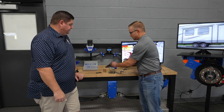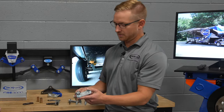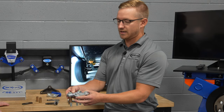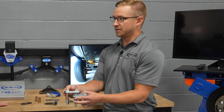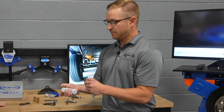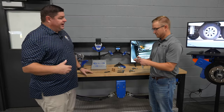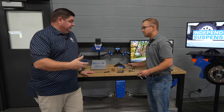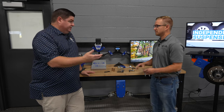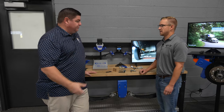Yeah, the difference is on this piece here. This would be a standard bolt, this would be a wet bolt. There is a greasable zerk, and inside the bolt itself, there's a hole where the grease comes out and lubes the inside of this bushing. So the wet portion is essentially a grease, which I'm assuming is a lithium grease of some sort, injected just like you would into a ball bearing system or the races and all that stuff. Yep.